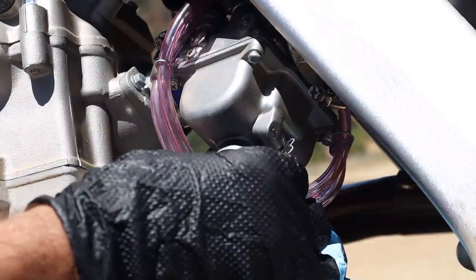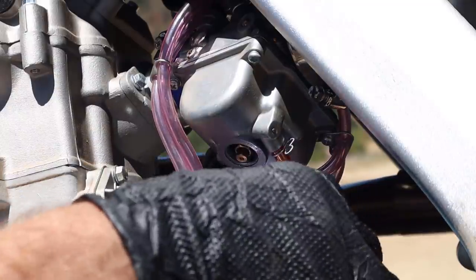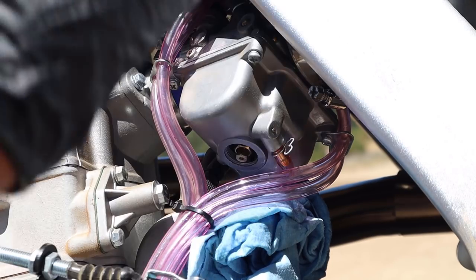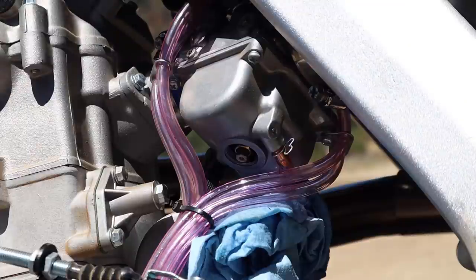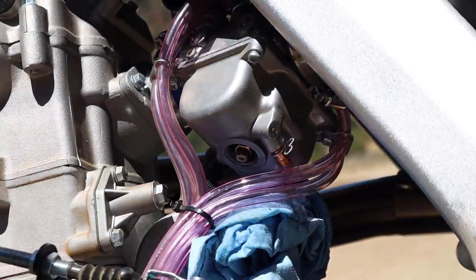But anyway, that was not as much fuel as I thought would come out. So we didn't even get a bunch of drainage down the back of the engine while we rotated the rag. That's good. Pretty clean in there, as it should be as a new bike. So first things first, go ahead and locate your pilot jet and take that little bastard out.